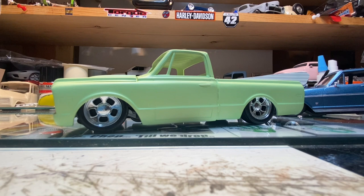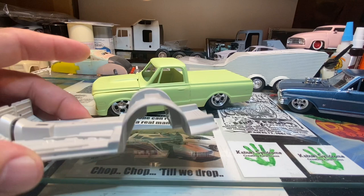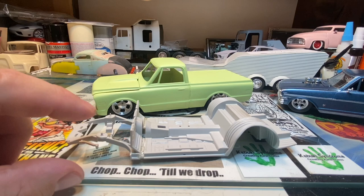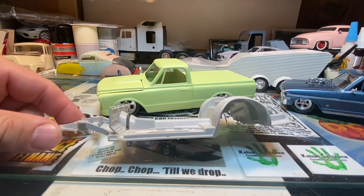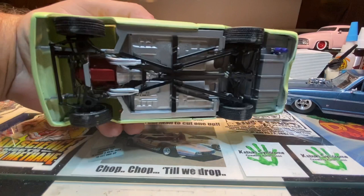He did it to a 78 Ford pickup truck and a couple of other trucks. What NASCAR chassis do is — with the higher wheel arches — being that those wheel arches are so high above the tire, you can get a car on the ground and still fit a tire within there without modifying the wheel arches. You can modify the spindles or adjust your upper and lower A-arms to get a squatted-down look, like an air ride suspension, to get the lowered look to the front. That's what's underneath this truck.